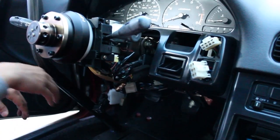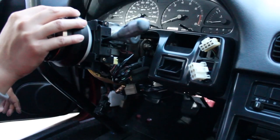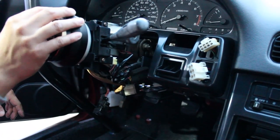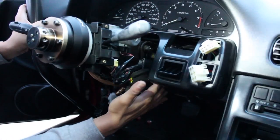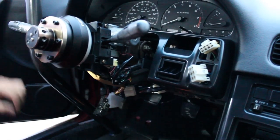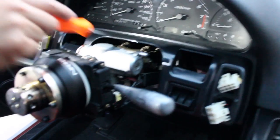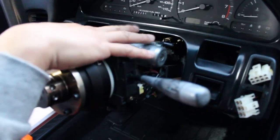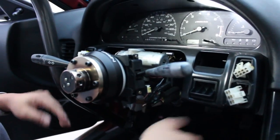These are the clips - you're probably going to have to use a long flathead and navigate through the back to remove this. Once that's done, you should be able to move this part. To make this job easier, I highly suggest that you drop the steering column. There's going to be two bolts here - I forget what size - but it's this bolt right here and adjacent to it. Two bolts that will allow you to drop the steering column down to give you more room to pry this plastic piece out.